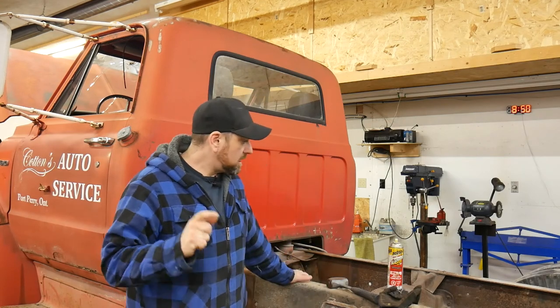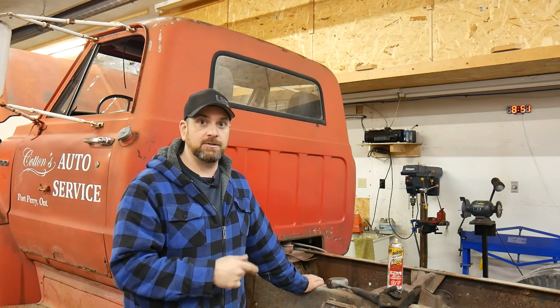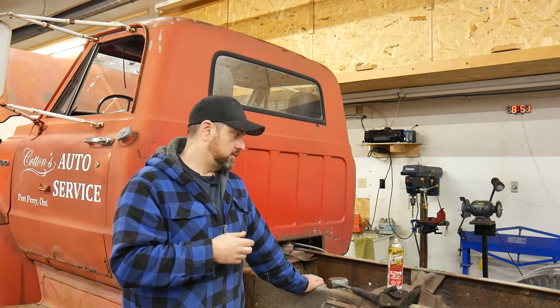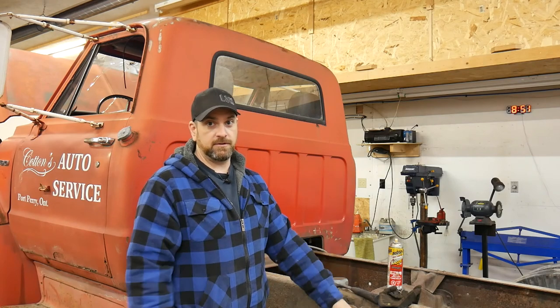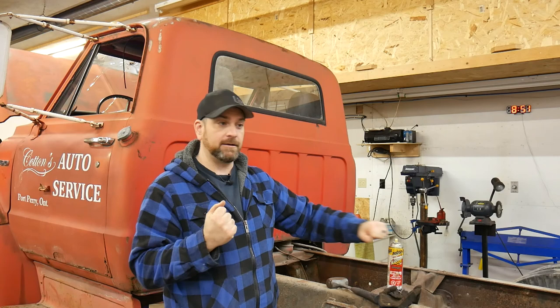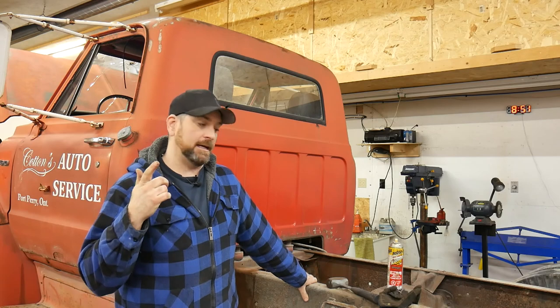So that's the decision for later. Next steps: figure out what engine to put in, then deal with the leaf springs and figure out the suspension. I'd like to do air ride in this truck. In the back I'll probably end up doing some type of four-link setup, maybe replicating the old-style Chevy trailing arm suspension with my own trailing arms and a panhard rod. In the front it's a straight axle, so I'll probably try and mimic some of the newer trucks' front suspension setup. Either way I'd like to run bags in this and just make it a pretty cool truck. Thanks for tagging along — please subscribe to the channel and hope to see you again.